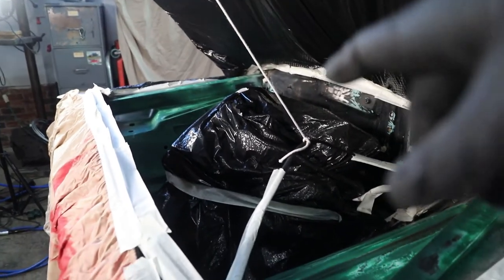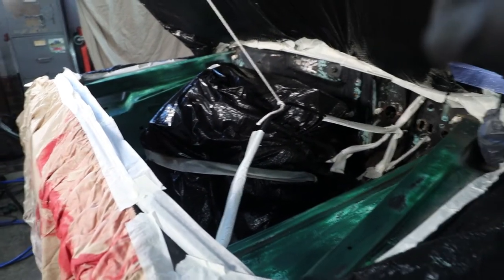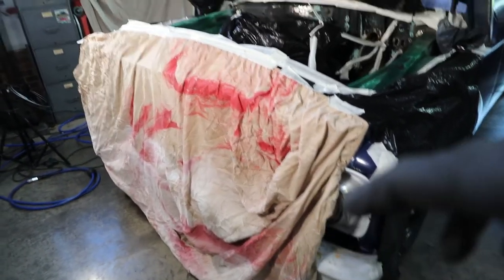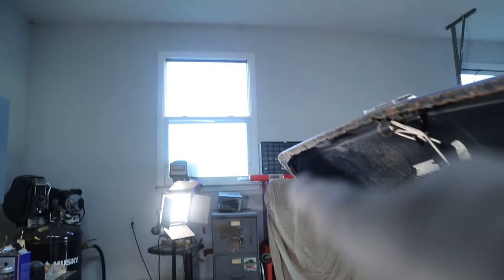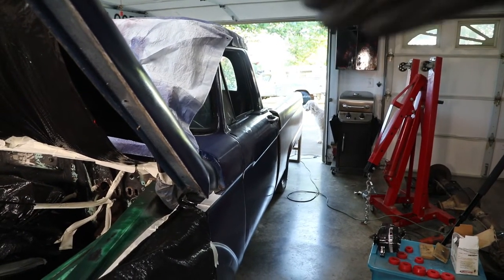So what I've got to do right now is hit all this with wax and grease remover two times. And then what I'm going to do is wet the garage floor somewhat for keeping dust down, but the other part is if the floor's wet, the overspray doesn't stick to it very well, so that way it's a little bit cleaner. And then once I get done spraying outside, I've got my top window open there. I've got a couple fans in the back here. I'm going to drop this garage door down and let the fans draft out that way as much as I can. That way it's not going near my tools and everything, and I've got my toolboxes covered up because I don't want those to get black.